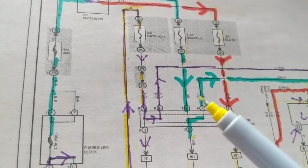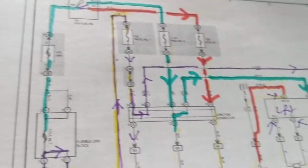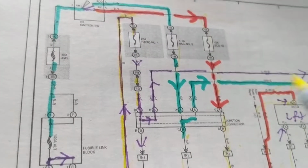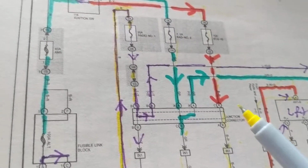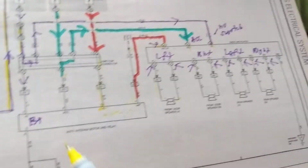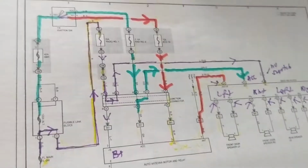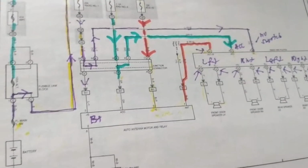Meaning you're drawing current over a while. A short is a short, and it'll blow it right away. An open means there is less current being drawn. A short means more current is being drawn. So again, pay attention to these things, and like I said in my prerequisite, the other video, it'll explain exactly how it works. Thanks for watching.